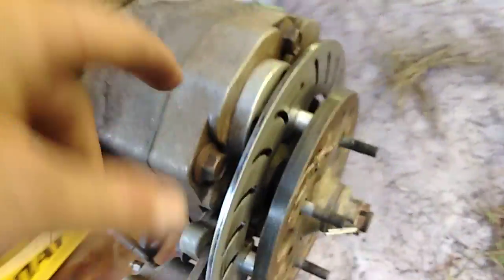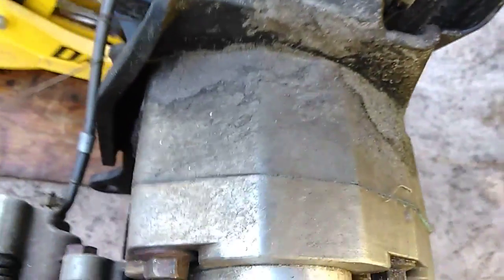The next issue I started having was cutting gaskets. So this gasket, as you can see, goes all the way around the box, and they say torque it down to 60 foot-pounds, yada, yada, yada. But as you can see how wet all this is? And sand sticking to it? I didn't clean it just for the purpose of this video. You see all that wetness? See how there's gear oil on that bolt?